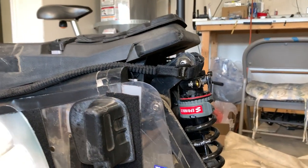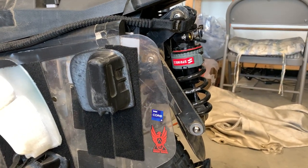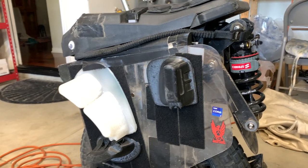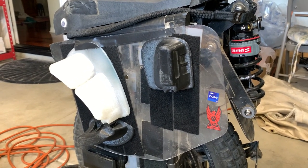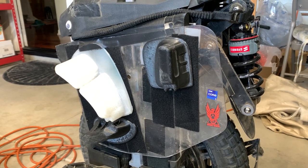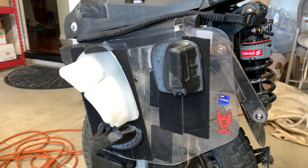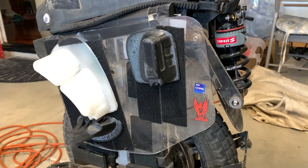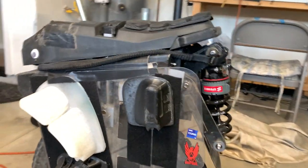So I updated to 100 millimeters of suspension travel. Now I can run 25 millimeters of sag and still have 75 millimeters of compression, and that is just about right for me. I did get to try Roger's Extreme yesterday on the Mount Wilson ride. You can definitely tell that 130 millimeters of travel — I thought it was going to be excessive — but you really can tell that the extra travel goes a long way in allowing you to have the right sag, and also have enough space for a nice progressive compression so it doesn't feel like a very fast ramp or a very harsh suspension.